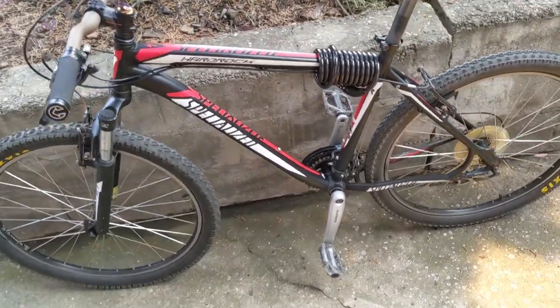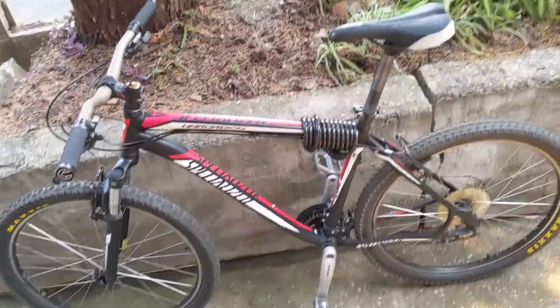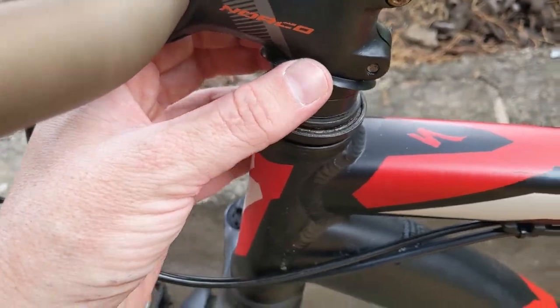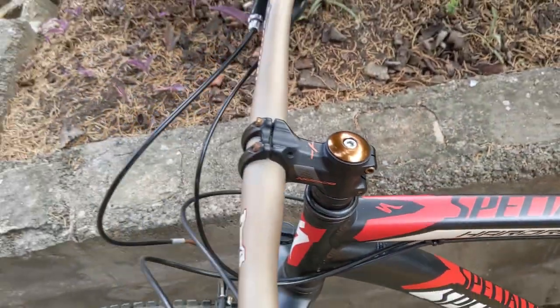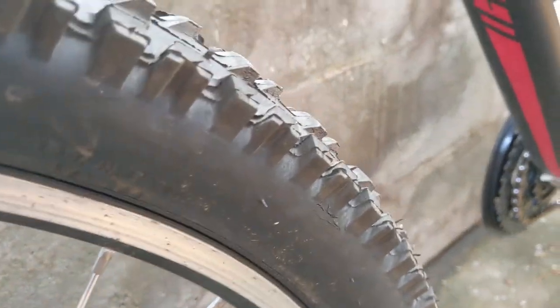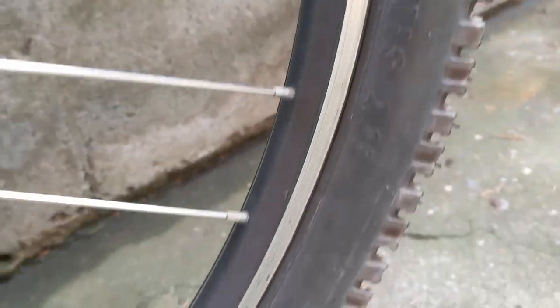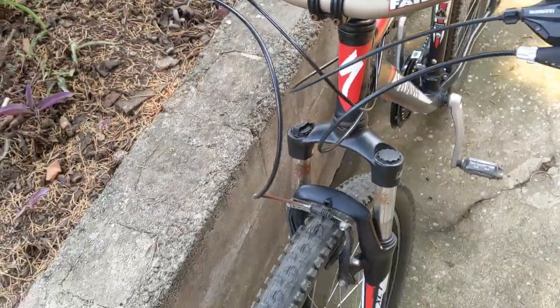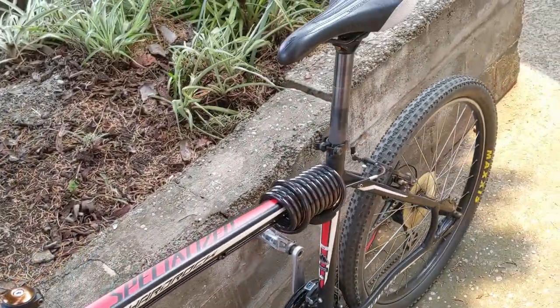I've got a spare bike lock so I'll leave this outside as my quick run-to-the-shops bike. I've noticed that the headset bearing dust cover has come up — it's probably going to get pretty dirty in there and might need replacing. The front tyre does have a few cracks in it, but if you look closely it still looks brand new — it's still got all the little rubber bits on it, the tyre's barely been ridden. It's obviously just been put on and then stored, so it's got sidewall cracks but it's still holding air. The shocks work — I need to adjust the rebound setting and make the preload a bit stiffer for my liking, but that's it.